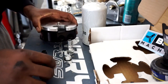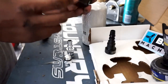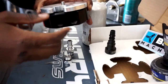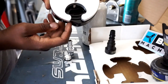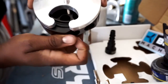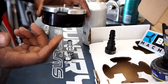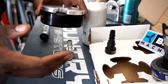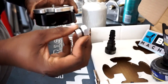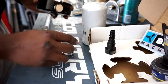While the tank is draining, I can go over what we're going to be doing for the new sump. The sump has two ports — pressure/suction and return. The easy way to tell: your pressure or suction line is going to be the one with the bigger bowl on it. Your return is just the small one. Now my return is actually on the top of my tank because that's how it was when I installed my Air Dog, so I'm going to leave it there — it's just a return line. I'm going to use the provided plug that Beans sends out with their sump and put it in the return port on the sump.